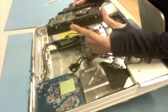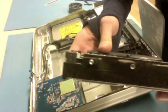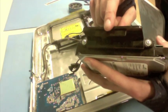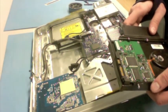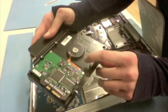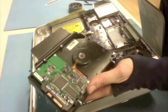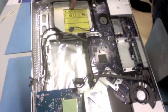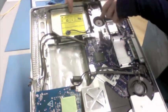If you are going to be replacing this drive, there are four more screws that you're going to want to take out. You've got a T8 here, a T8 there, and then on the other side you've got your two T8s. You want to make sure that those are transferred along with this bracket to your replacement drive. The other thing is that on some models — it looks like this model does not have it — there is going to be a heat sensor stuck on the drive, held on with double-stick 3M tape. So you want to very carefully, with your black stick, pry it off and stick it to your replacement drive. It's similar to the blue board right over here — a little sticky board with a black heat sensor cable coming off of it.